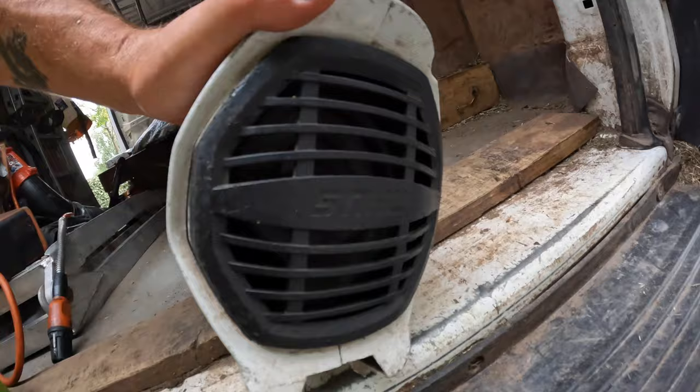I then took off the end cover — there's another cover that covers the back of the motor. No real wires or cables in there, but I had a look. The one thing that did stand out was all that rubbish and dust on the inside was also on the back end. It was like a greeny, browny, polleny, dusty thing, and it was stuck to everything. I blew it off but it was still there. So I thought that must be the issue — it's just not making contact enough as it goes around. I got some WD-40 — I didn't know whether this was going to work — sprayed it in, gave it a brush, got most of that gunk off, and it worked. And it's still working fine now.